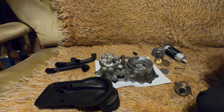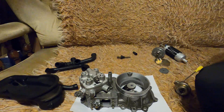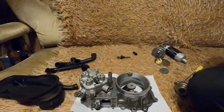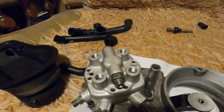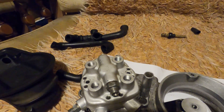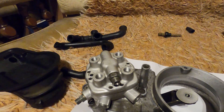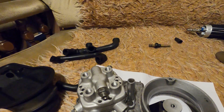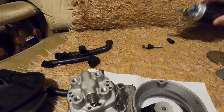If you have to readjust the mixture out of who knows which reason — for example your car won't even start — the first thing you will have to do is take off your fuel pump relay and bridge contacts 87 and 30. Contact 30 is the positive coming from the battery, and 87 is the positive going to the pump. So you practically bridge two positives and make this pump run non-stop.